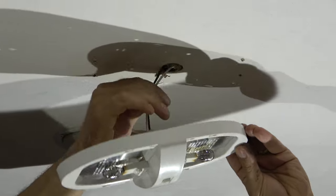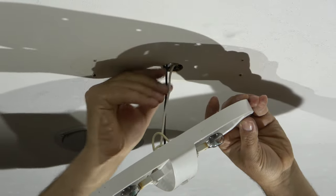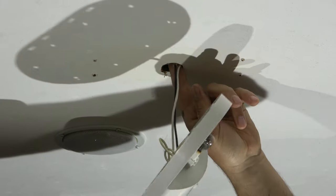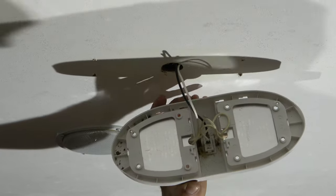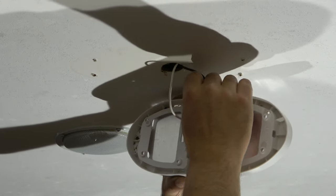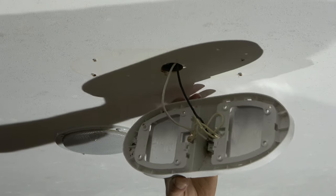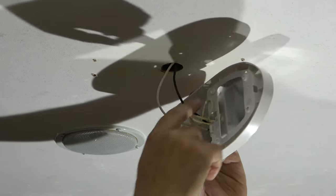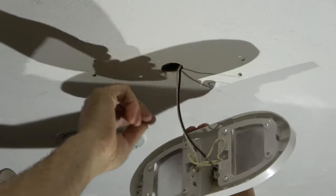When you start pulling it out of the ceiling there should be some splices in here — some insulation and all kinds of stuff. There are wire nuts up in here where they splice all the wires together to go to all the lights. On the underneath you've got your black hot cable and then your white is going to be your ground. In most RVs that's how it works — black for positive, white for neutral. This one's just got a little clip you unclip, and this one's stuck on there so I'm going to have to cut that one off.